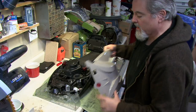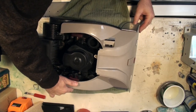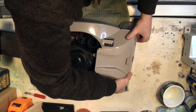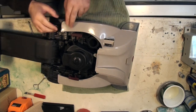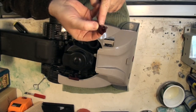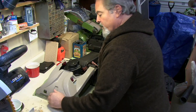Gently press the hoses on, then put the upper cover back on — pivot it from the front, line it up, and give it a good snap so the whole thing snaps down into place. Make sure the sides are also snapped down, then put the screw back in. The brush switch has a little hooked lever that engages back onto the brush switch arm.